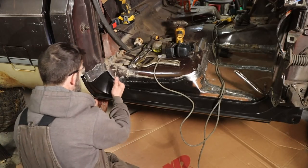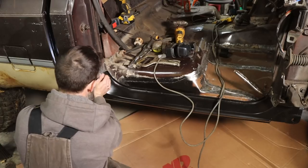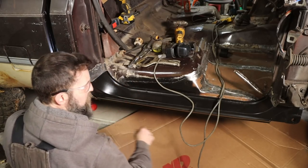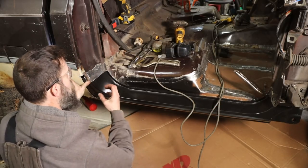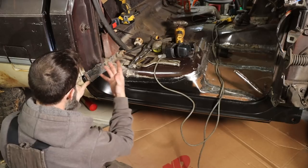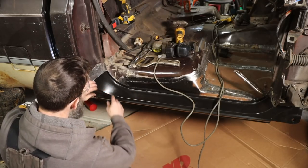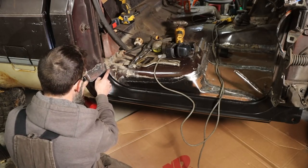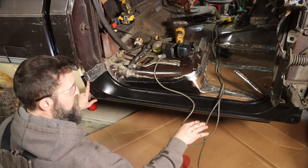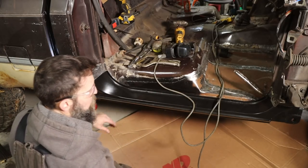After a couple of trips on and off, I think that's about as good as it's going to get — really close. There's a little lip there we're going to have to bend in; these never fit exactly perfect. They're not the exact mold that the original rockers were made from, but they fit good enough and once you do the body work you can't tell anyway. We need to bend that in a bit, then lightly tack it in, hang the door, make sure it fits, and then start welding it in. I still have to punch all the holes and all the other good stuff.